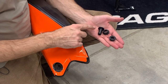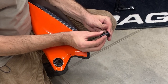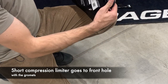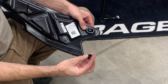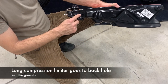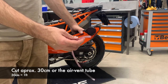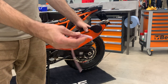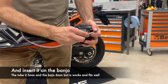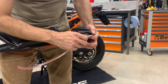Now take the compression limiter — let's take the shorter one — and two grommets. Put the grommet on the compression limiter like this. The shorter one you will use here, so you put it from the outside of the tank. Then flip the tank and put the second grommet from the outside. Do the same in the back of the tank, only using the longer compression limiter. Now cut about 30 centimeters of the air vent tube and insert it on the angled banjo — the banjo is 6mm and this is 5mm so it goes a little harder, but it fits well.